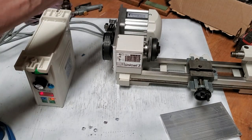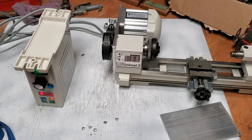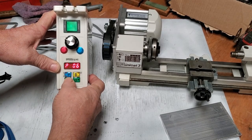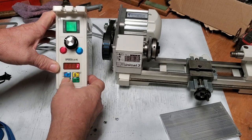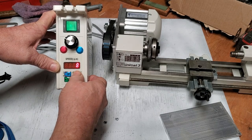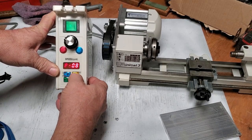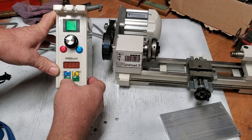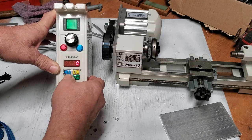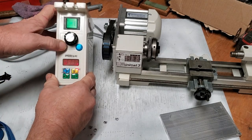So now I'm going to explain forward and reverse and why you're going to set it soft versus tight. We're going to go into programming and set P6, which is acceleration, up to — let's say 8; that's pretty fast. Save it, and then we're going to go up to braking, which is 8, and set it to 5. Then we're going to try it out.